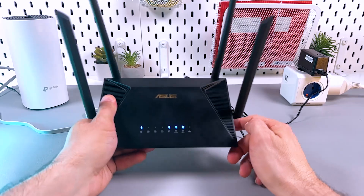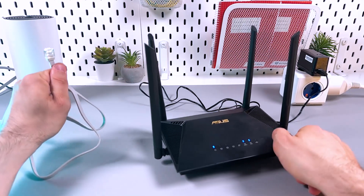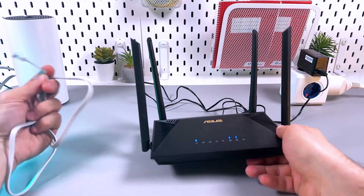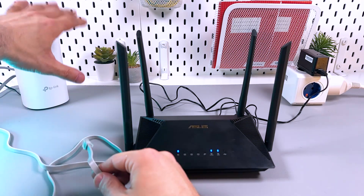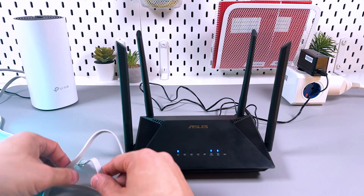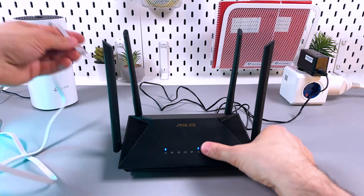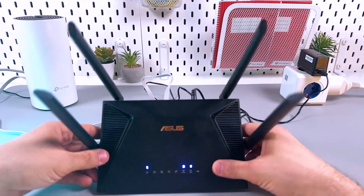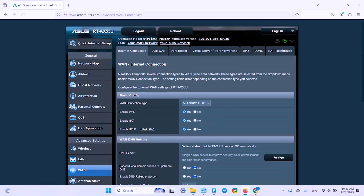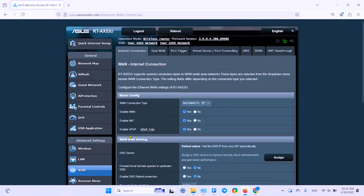If you still can't connect to Wi-Fi after changing the network name and password, try disconnecting the router and connecting your modem directly to your computer. If you still don't have internet, check everything near the modem: all cables and LED indicators depending on your modem model. If everything looks okay but you still have no internet, reconnect the router and go back to the graphical user interface in your web browser. Navigate to the WAN settings and contact your ISP to verify those settings are correct — if there's no internet even when directly connected to the modem, your provider should help resolve the issue.